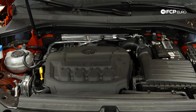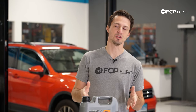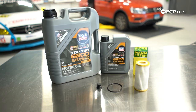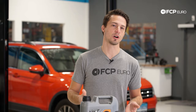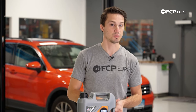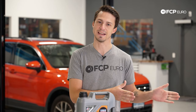What's unique about this new engine? It looks exactly the same as the standard 4-cylinder 2-liter turbo engines from Volkswagen but this is a new version — this is the Gen 3. It uses a lighter viscosity oil, a 020 or 508 spec from Volkswagen. It also uses what they call a Miller cycle, which basically closes the intake valve a little bit early and allows for a more complete combustion, making a little less peak horsepower, a little more torque, but much more fuel efficient compared to the GTI or Jetta variants of the early version of the EA888 engines.